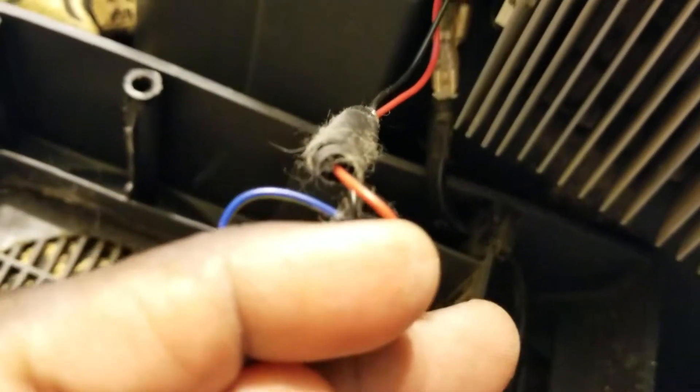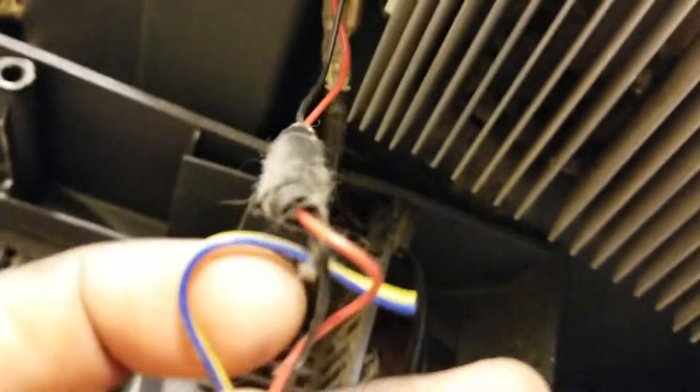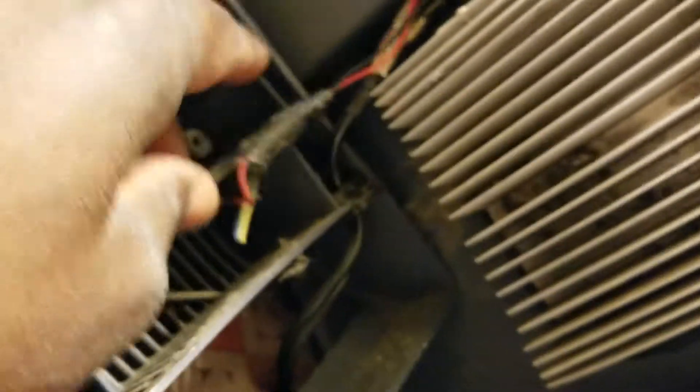When you put it in, don't get scared when you see a bunch of wires. The only wires you're going to mess with are the red wire and the black wire. You're going to cut those two wires. What I did was tape them — black going to black, red going to red — and put tape around them both and hold them together, then re-tape it. That way if I need to replace the fan again later it's easier, rather than soldering and having to keep cutting the cord shorter.